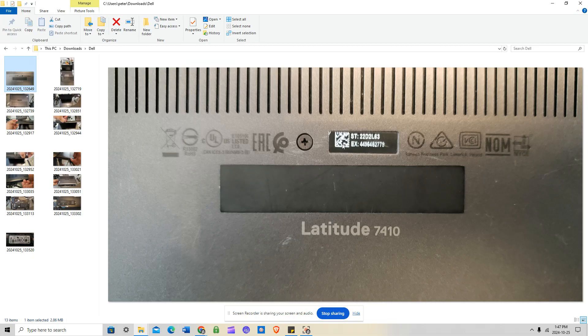To make sure you're being brought to the right place, just do a quick Google search on Dell service tag lookup or warranty lookup. You're better off using the service tag. Once you input that, they'll give you the exact model — the 7410 — along with a full breakdown of specs: motherboard, USB ports, maximum RAM, and more. For this specific model, all we're doing is replacing the 2280 series SSD.